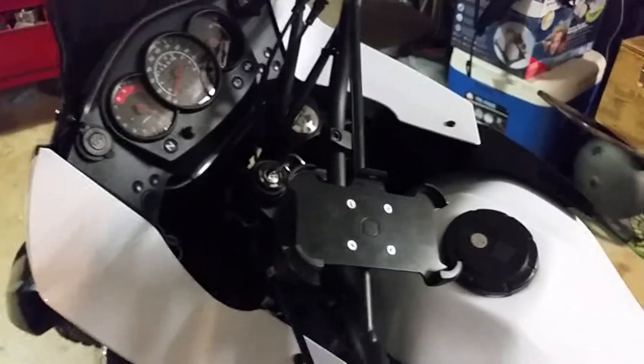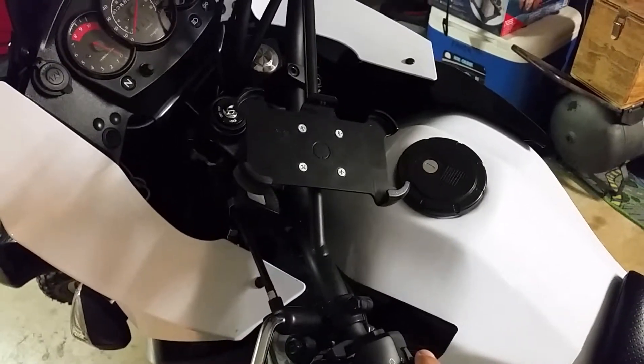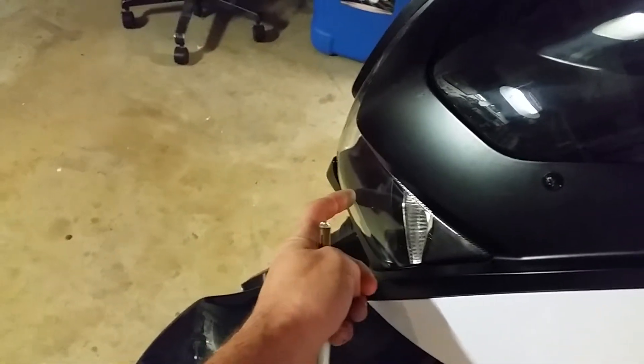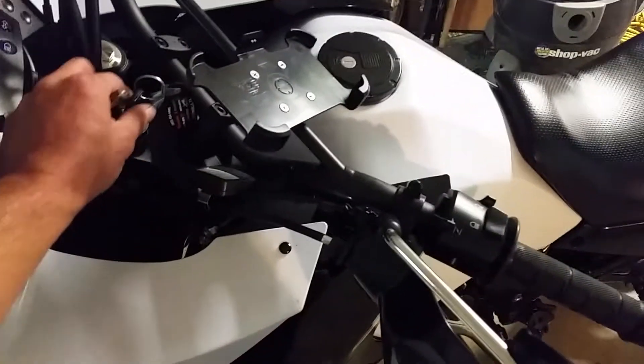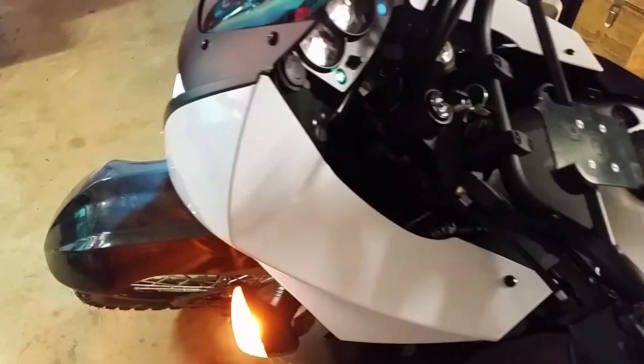If you don't put those diodes in, when you turn on the key and hit the flashers, it would make the headlight flash, which really wasn't cool. Not with the key off, but with it on. But with the diodes in, it really works great — turn it on, it flashes, no blinky headlight. It kind of overrides it whenever you turn the key signal on, but still it's working fine.